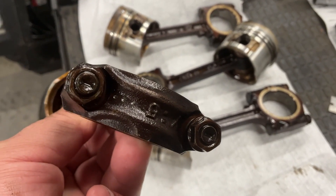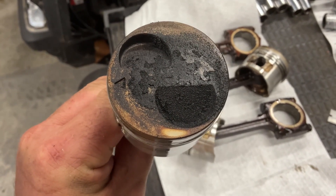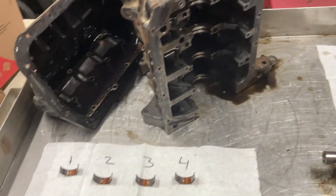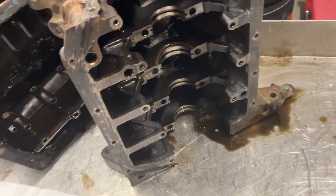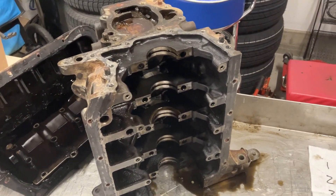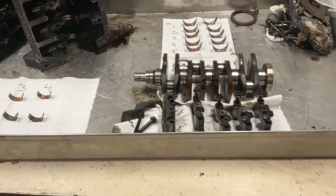The pistons have got a little arrow on the head that points to the number one or crank pulley end of the engine, so you can't get that wrong — although actually, I did buy an engine once where a guy had the pistons in backwards and it does hit the valves, so you don't want to do that. The block — we showed you the top of the block, the bottom is filthy dirty. I'm going to give it a good clean, take it to the machine shop to clean it and machine the deck, and then I'm going to do some measuring and see where that crank is at. The next video will be when the parts are all cleaned up and maybe ready for reassembly.